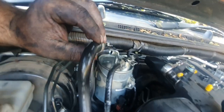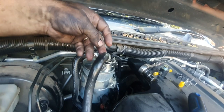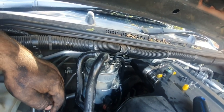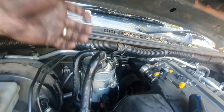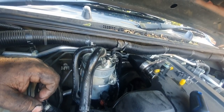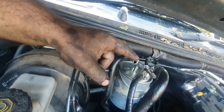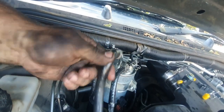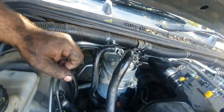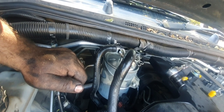Now I have left this hose off, because when we start priming, it pushes the air out a lot quicker, so it primes the filter a lot quicker. And then once we start getting fuel out of the pipe, we'll put this hose back on, and then we'll keep priming until the primer goes nice and hard, which indicates there's either little or no air left in the system.